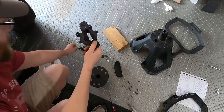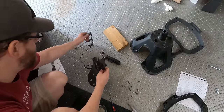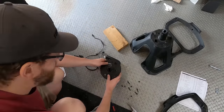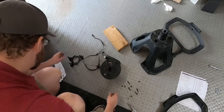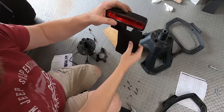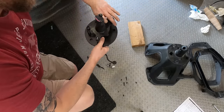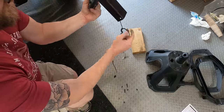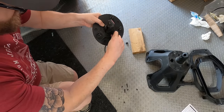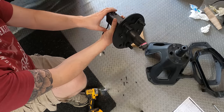We do reuse the camera and brake light. I separated the tire carrier into two pieces and the stud plate, because we're going to reuse that as well. The camera mounts on the bracket, with another plate that goes on the back, and we reuse the factory stud plate with the 5x5 bolt pattern. We mount the factory brake light to the top of the bracket, thread the wire through the back of what they call the stinger, use the factory studs, and put bolts through to hold it all in place.